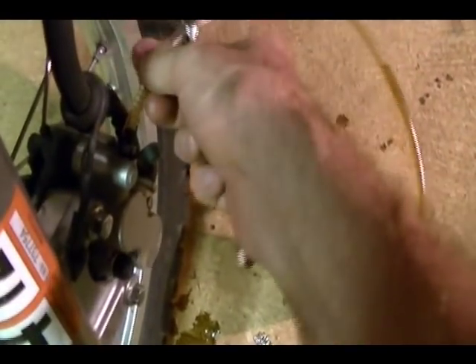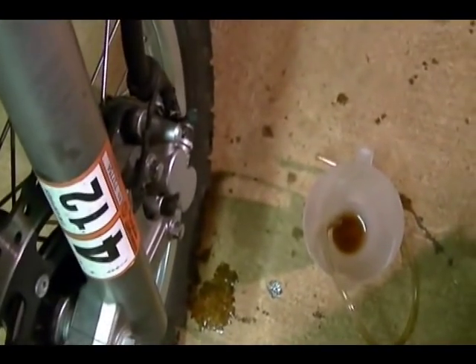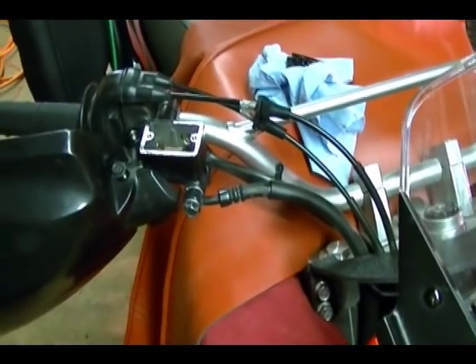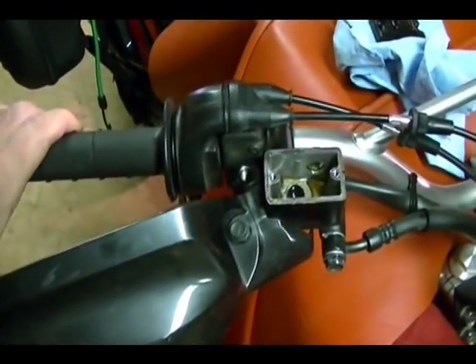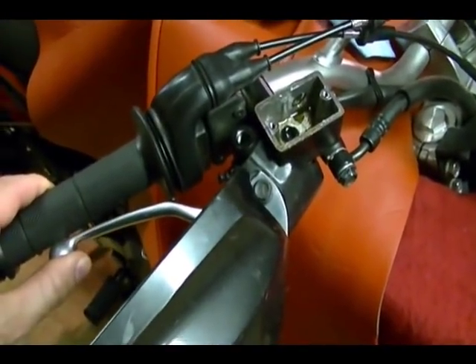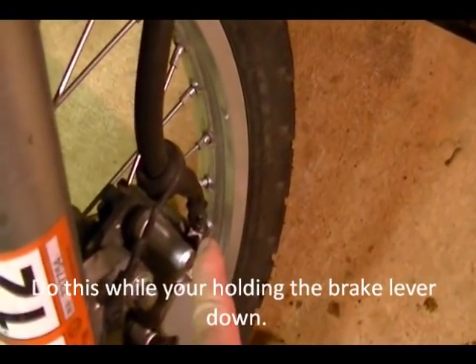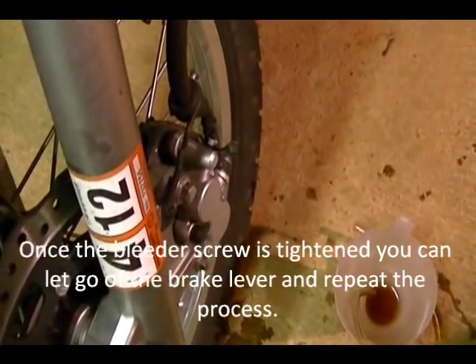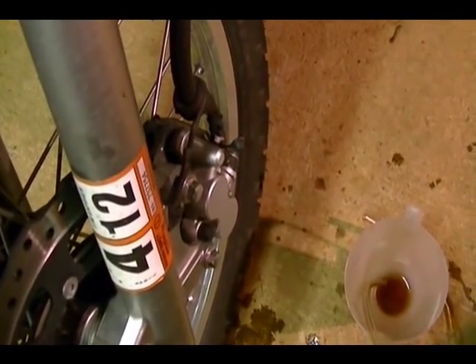We can remove the hose and get ready to add new brake fluid and bleed it through the system. There are a couple of ways you can bleed the brakes. The first method — the more difficult one — is to fill your reservoir, compress your brake lever, hold it, then come down to your brake caliper, loosen the brake bleeder screw and let out any air or brake fluid, then tighten it and repeat the process about 10 or 20 times to bleed the air out. But that's the more difficult method.